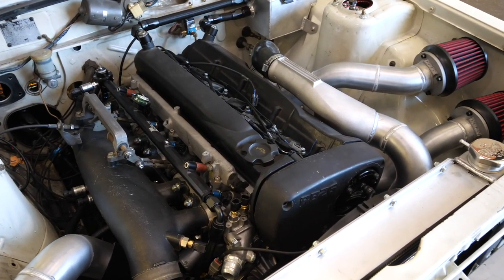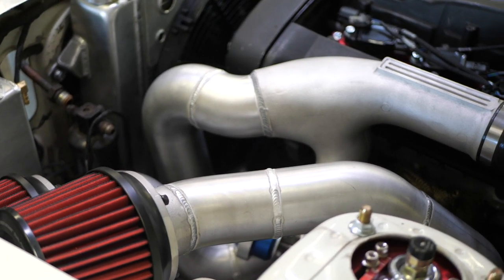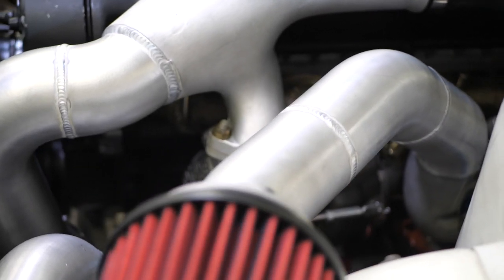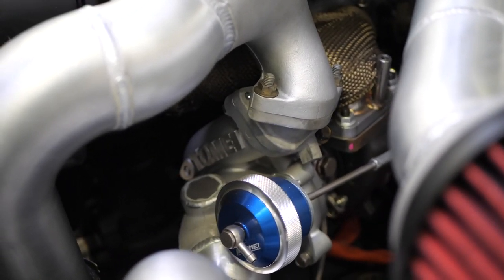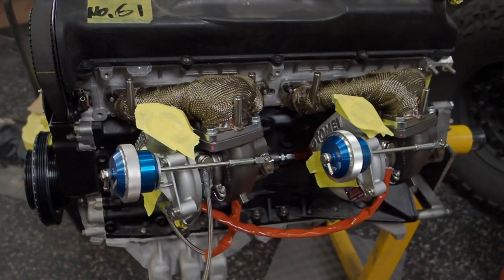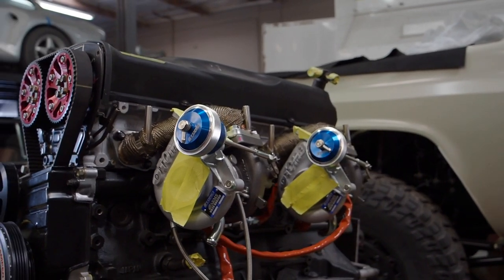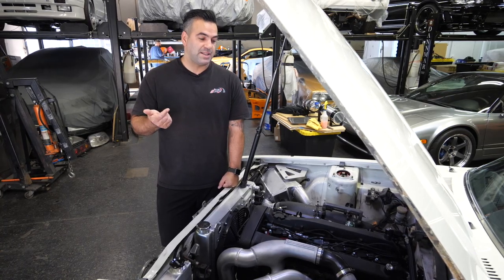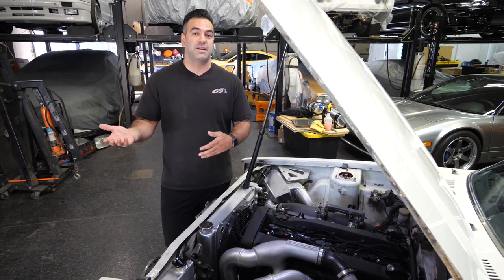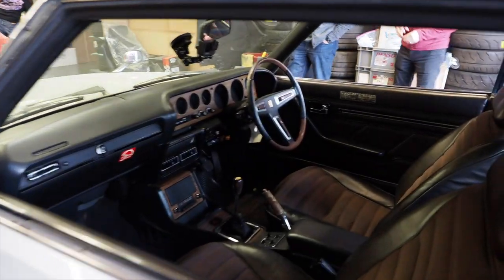Starting on the hot side, this car has an RB26 — it is a built and forged RB26. We'll get into the specifics later, but what you can clearly see is that it's got a Tomei Arms BX 8260 twin turbo kit, with Tomei X-frame outlet pipes — one at the top where the cam angle sensor used to be, and one at the bottom. Originally we were going to go with a single turbo setup with a G3770 and a large A/R for top-end power, but we decided when this motor was going into the Kenmeri, we wanted more response while still having the capability of hitting 600 horsepower if we wanted.